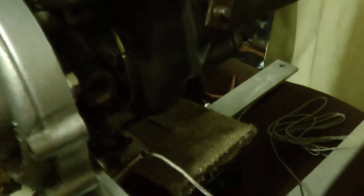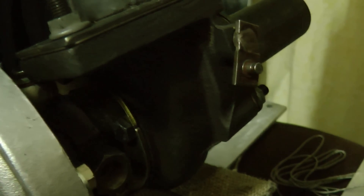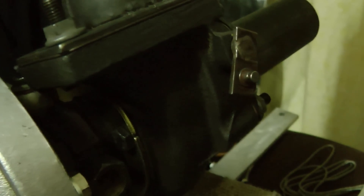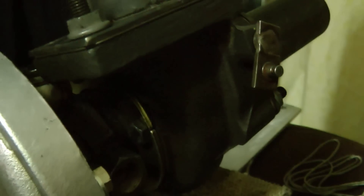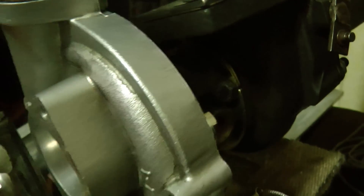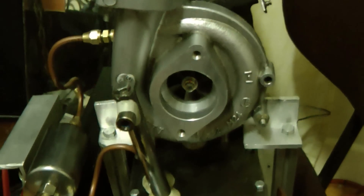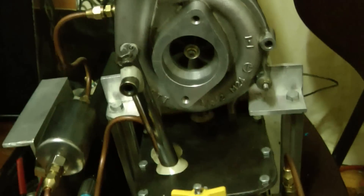Instead of welding the actuator shut — which will destroy your turbo — I still want to have options later if I want to use the housing for another turbo. So what I'll do is I'll just weld something on there with a bolt so you can just bolt it closed with the actuator. Alright, I'm running out of time with the video. Please thumbs up, subscribe, comment — any ideas? I've given you all this information especially about the fuel, so do me a favour, thumbs up and subscribe. Then I can give you more information and help you guys get these turbos and turbines running without costing you a whole heap of money. Thanks for watching, please subscribe.